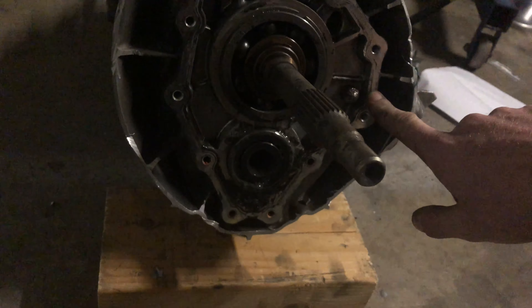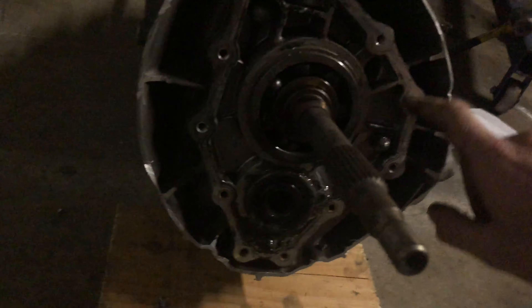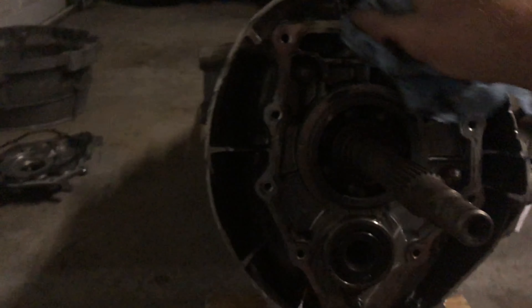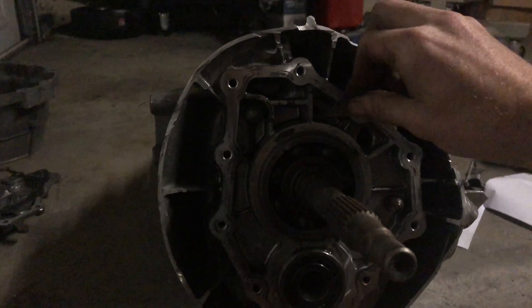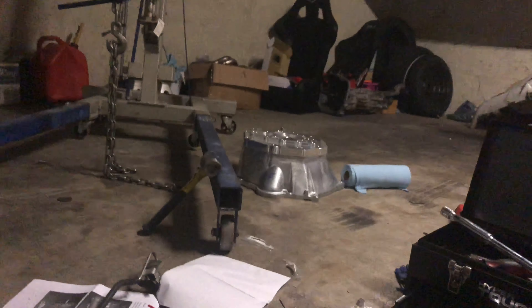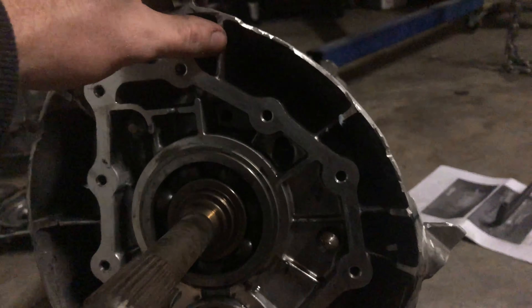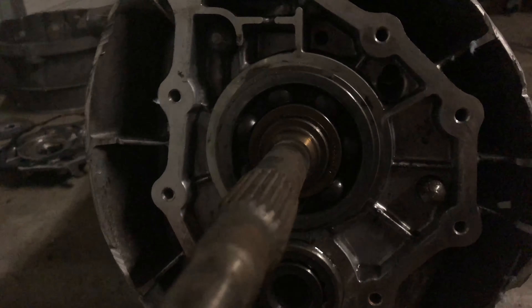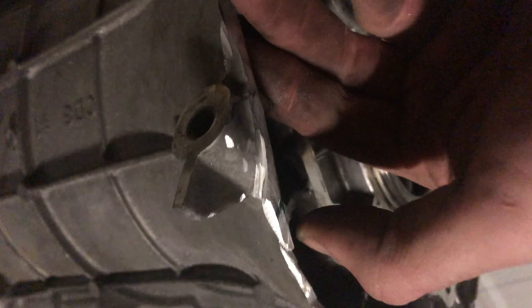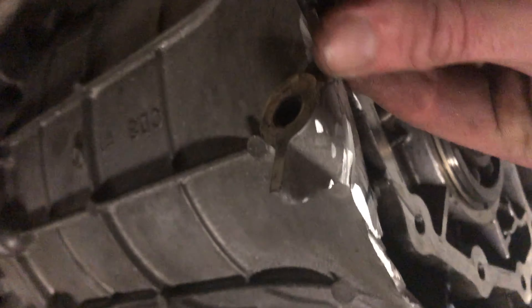I got the surface pretty clean so I'm going to go ahead and test fit the bell housing, just to make sure there's enough clearance between some of these notches that were left over — I don't want to put RTV down and then try to put it on and have it be all messed up. I noticed it's touching where this mounting point is for the 350Z. I tried to go around it and it came out really rough, so I'm probably just going to have to chop at it until it clears the actual adapter plate.